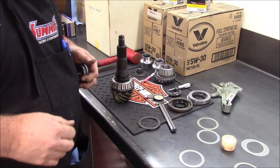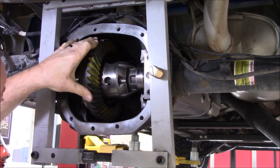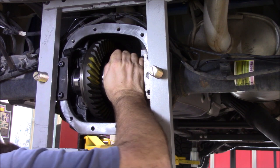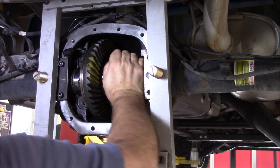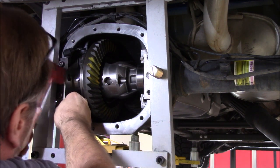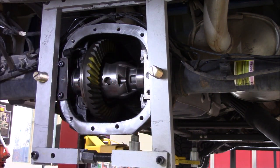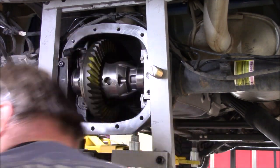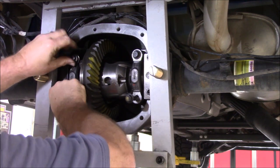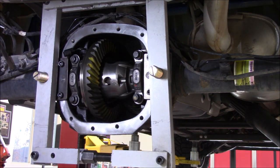Let's go back over to the truck and put the pinion in with the new 30 thousandths shim. I don't think I gained much in backlash — I'm going to want to see where the pinion's running, but I'm definitely going to be pulling this back out again to adjust some carrier shims. There's not much backlash there, so the carrier's definitely coming out again. Very seldom is this ever a one-and-done process.